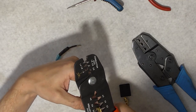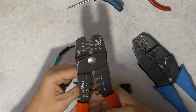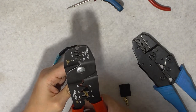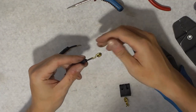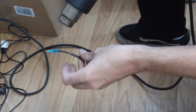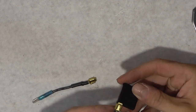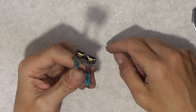This seems like about the right size. Start big, go smaller. It's actually pretty good — just a tiniest bit of movement. We'll just crush it in the old crimper. That's on there tight. Make sure we have the insulation clamper thing clamped. That's not too pretty, but we've got some kick ass shrink wrap. Hit the shrink wrap with a heat gun. These things just slip on in — tab on the back so it clips. A nice little click. Cool. We've got our pigtail, the new hotness switch, and the new hotness wiring clip pigtail thing.